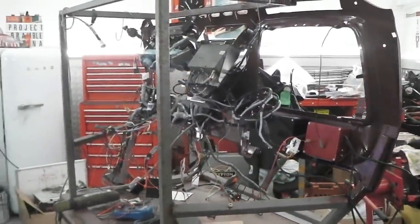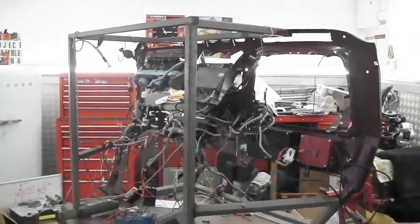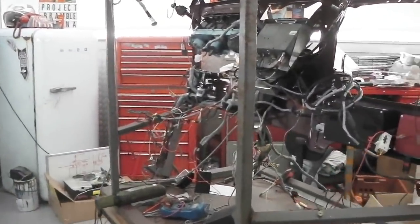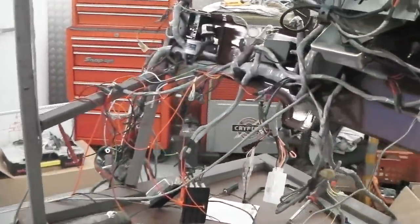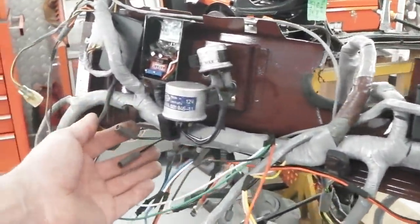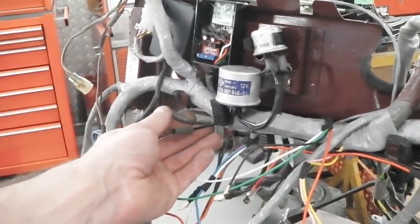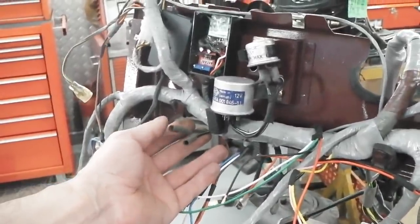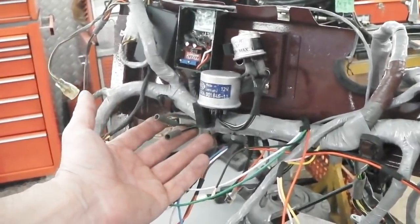That's where we're up to just right now. So at the moment I'm about to wire the hazard lights in. I've found myself some little Ford connectors, because the loom already allows for hazards to be fitted from the factory, and these are the tails for them. Black and green, black and white, they indicate left and right power lines for the indicators.